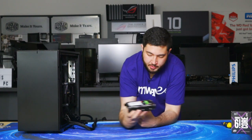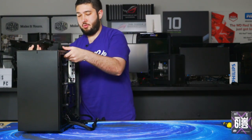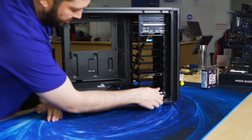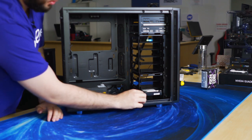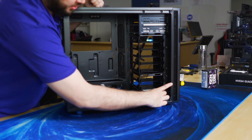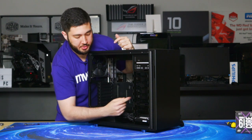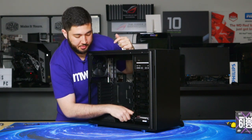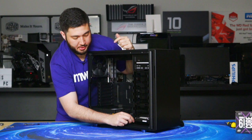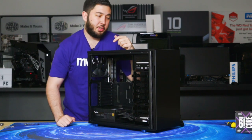Once it's in this form, it's more or less toolless. You just need to unplug the SATA data and SATA power each time. So, you just want to install your drive. So, the repeat process is, if you want to replace this drive, you will disconnect the cables at the back, hold down these two tongs, and you can slide it out. You would use this process for any other drive that you install. If you're transiting the computer, which we will eventually, you will also use another screw on the side to hold this hard drive in. But because we're going to test it first, we're not going to mount it to the hard drive cage, because we're not sure that the hard drive is fully validated yet.